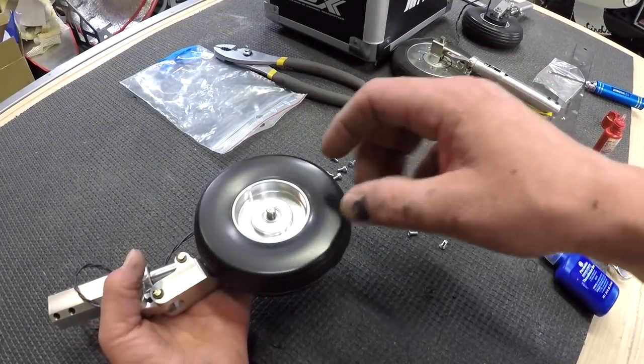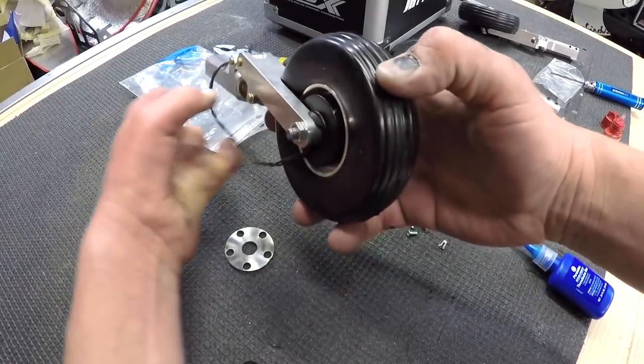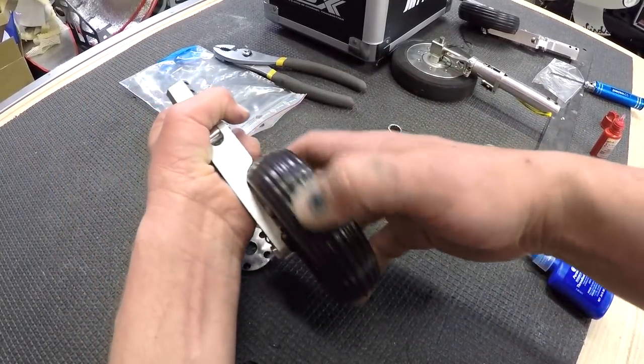Just so you're aware how this works: the friction surface floats, and this is an electromagnet. When you increase the magnetism it pulls the floating piece toward the fixed piece — the more magnetism, the more it pulls. That's how the whole brake system works. Now we'll put it together. It spins smoothly — but the tire is rubbing against the rim, which is a problem. We need to investigate that.